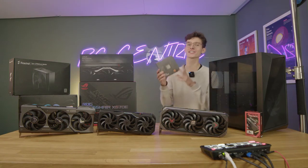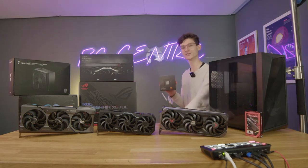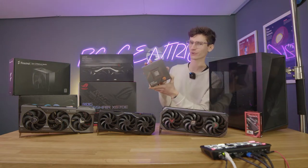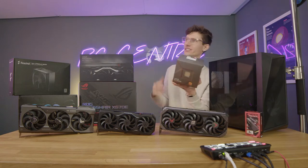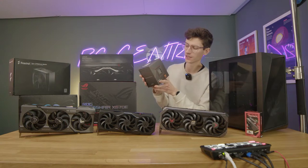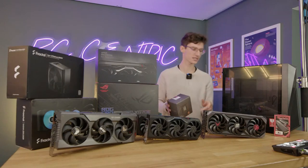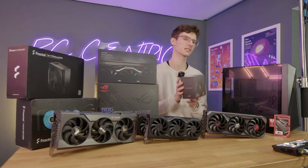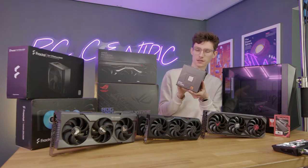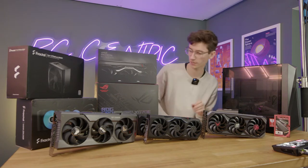We're using a Ryzen 9 7900X, which is pretty cool. It's a 7900X, not a 7900XTX, which I think is probably the Ryzen CPU to use for the XTX or a 4080, because at 1440p you will still see a little bit of bottlenecking, sadly, in certain titles. Even though the performance is very impressive, and if you enable Smart Access Memory, Resizable BAR, you're going to have the best odds, if you like, of getting the most performance, but you will start to see some CPU bottlenecking in certain titles, so please do be aware of that.